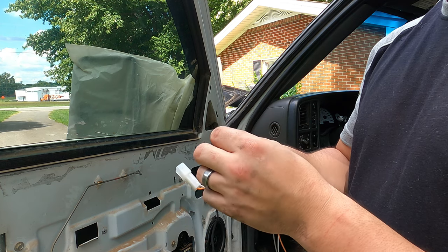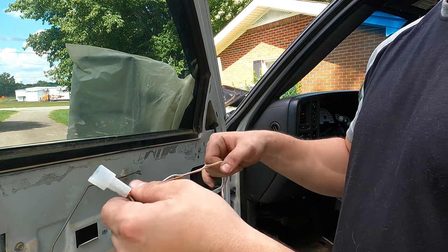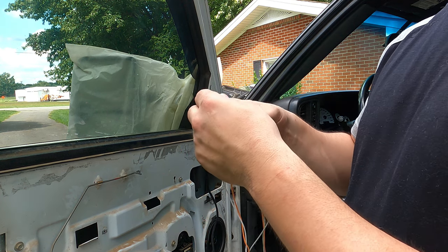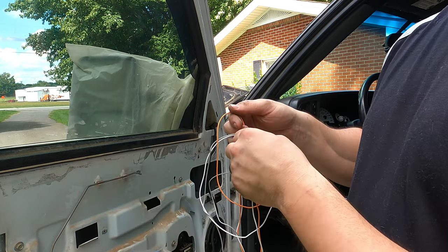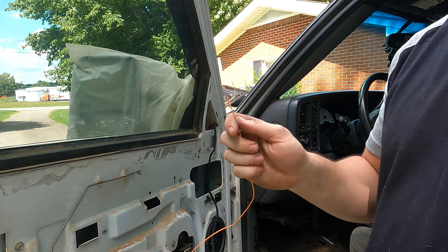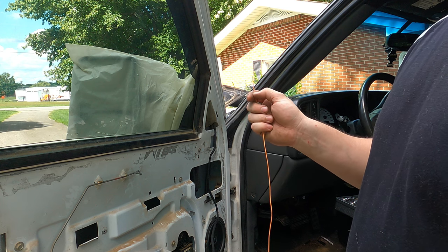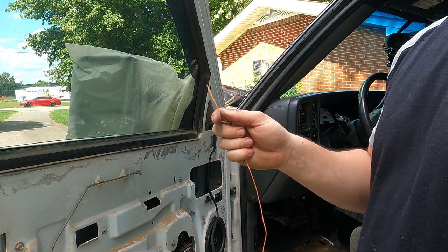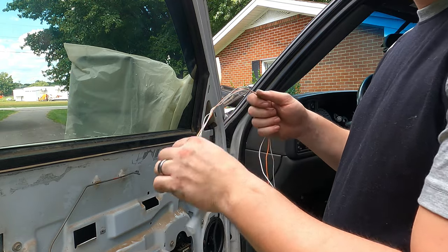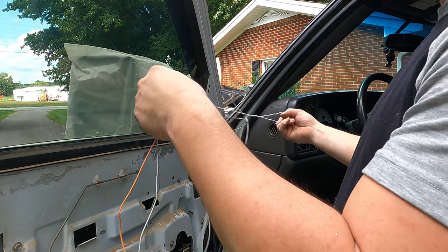Here's where it gets a little tricky. Most of it is easy plug-and-play bolt-in, bolt-out. But if you have what I've got — running lights — that's the orange wire. Your reverse and dome is the white wire, and your ground is the gray wire. You're going to want to run the orange and white up through the firewall. The white I'm going to do something else with. Run the orange up under the hood to the running lights fuse — they give you a fuse tap. There's a boot up under the firewall you can go through, or you can snake through where you have a sub.